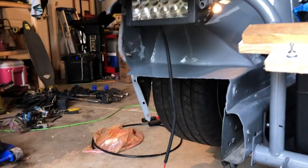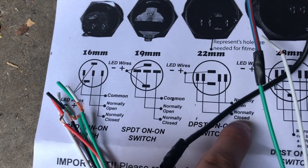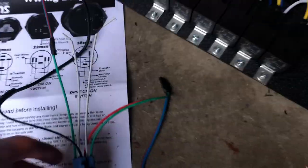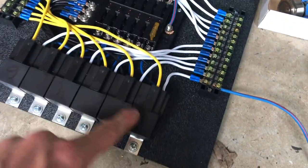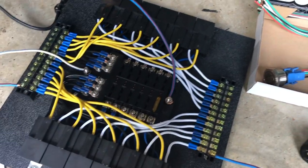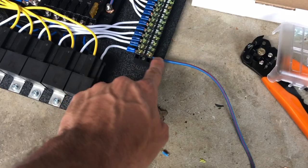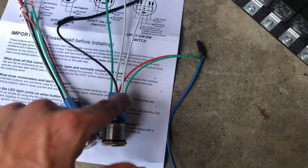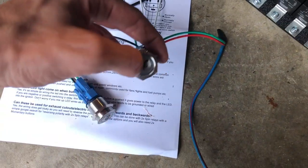So we'll attempt to explain exactly how you wire up these Build Specialties buttons. You can see this is their wiring diagram - you have LED positive and negative here. We'll forget about the normally closed and just use the outside. So first things first, the board has ground and power. This is our power going out - you can see this wire runs up to the light, comes in through the switch board, same relay follows down and comes out to this first piece. This is our power in from the switch, with normally open and the LED positive wire attached, so when you press the button the LED ring turns on.